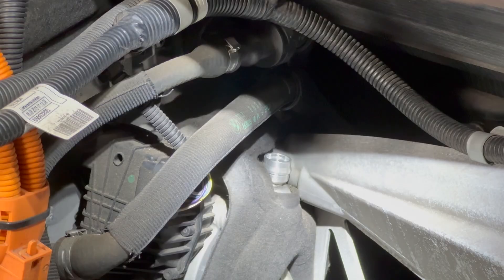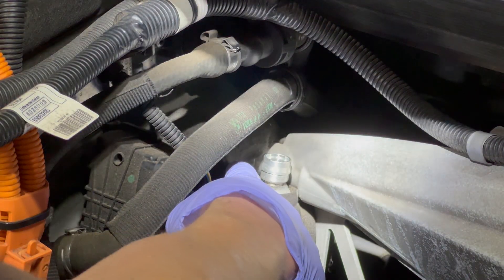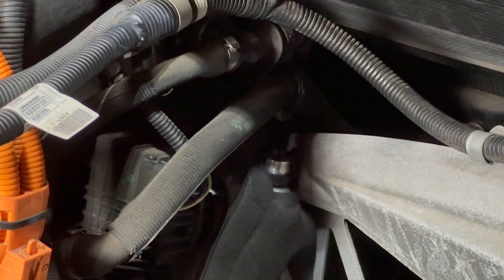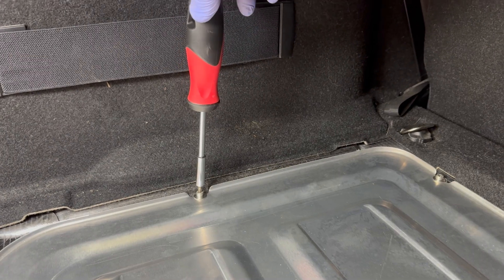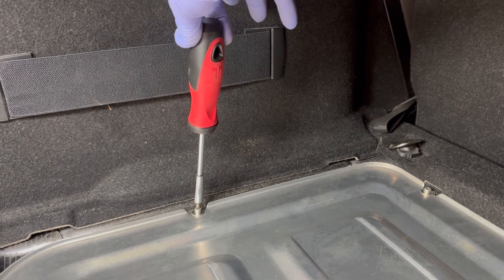Removing the pipe, then checking that the vent is clean and that there were no leaks of fluid where they couldn't be seen. The vent plug then clicks into position. When replacing the boot floor, the screws should be tightened essentially finger tight — apparently they strip out easily.